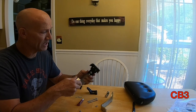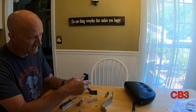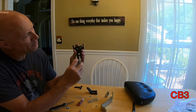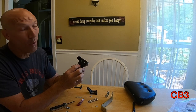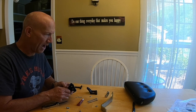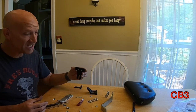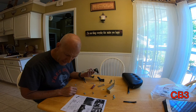There's a little notch that disallows the bracket from sliding out. I want this backrest to be something I can just grab and pull right out. So I'm going to loosen these up to show you. At the bottom of this piece there are two little notches that disallow you from pulling the backrest off. I want to be able to, when I put Coach Vic on there, just take this thing and — whoop — pull it right off. So those little tabs right there, I'm going to Dremel that off so I can lift this seat completely out of the Can-Am.